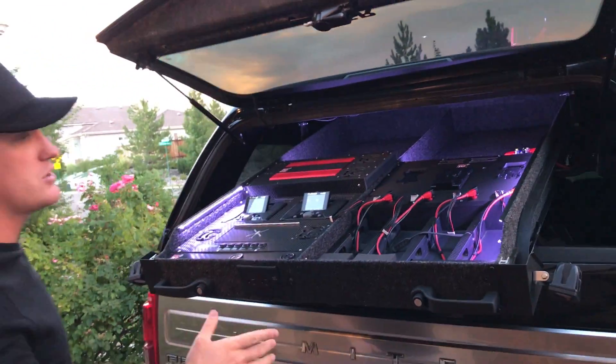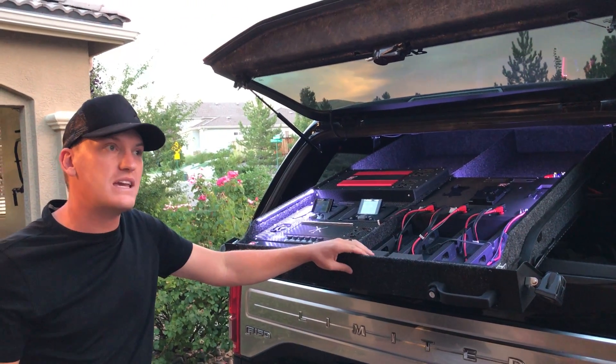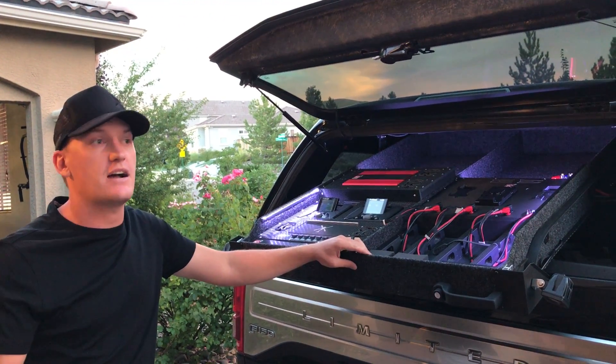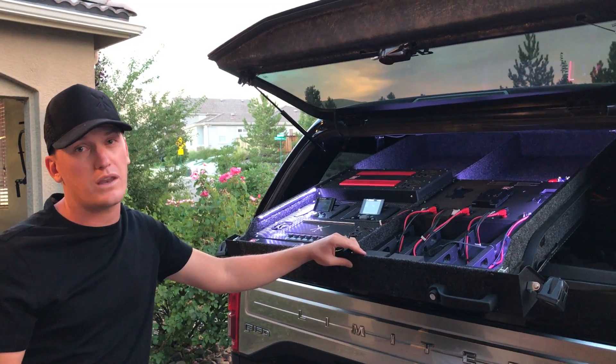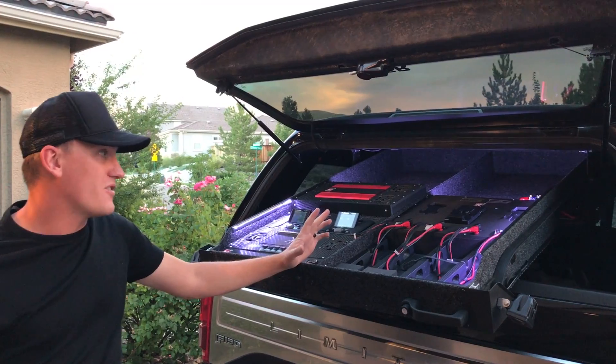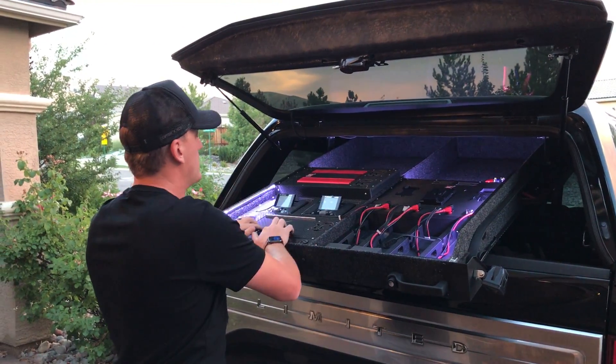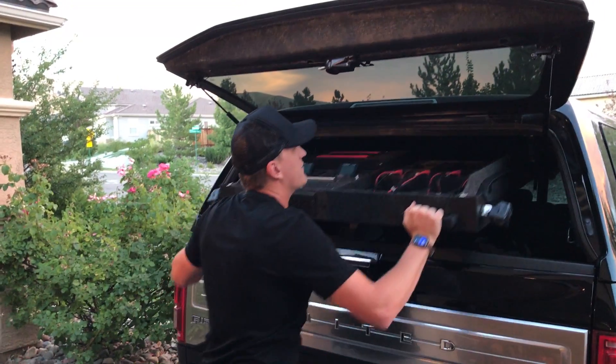Overall, it can handle charging. The truck at idle burns 0.33 gallons an hour, so about a third of a gallon an hour. I can idle for three hours on one gallon. That's just as efficient as a 2,000-watt generator, which is perfect. We can get it going, turn everything on, everything's up and running, put it away, store it while it's going, and drive away.